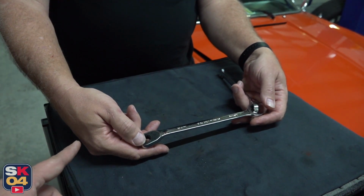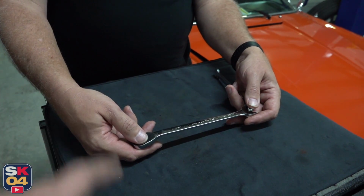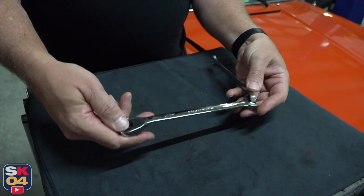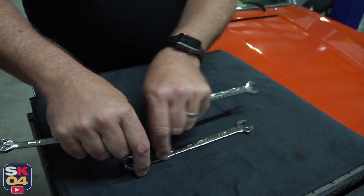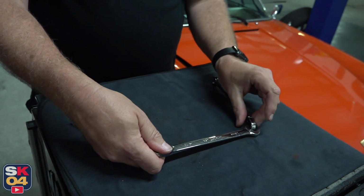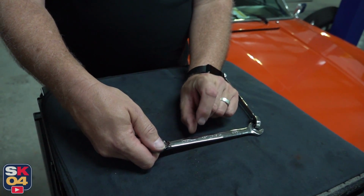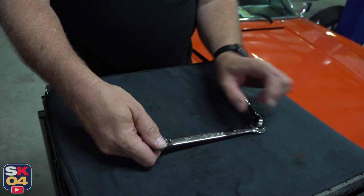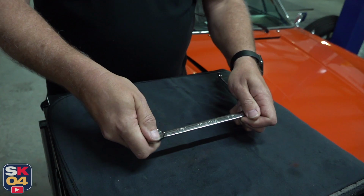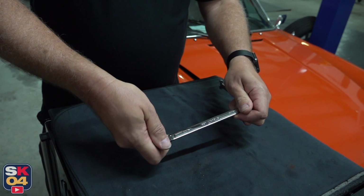With all the tire pressures double checked, Dan's going to work on disconnecting the sway bars before he starts making any adjustments, and I'm going to have Chris explain why. The sway bar is basically an additional spring in the car. A sway bar runs perpendicular across the car, with the sway bar arms attached to either side, or it's one single unit that spans the entire width. Based upon the diameter of the bar and the thickness internally, if it's a hollow bar, it develops the spring rate. As it twists up and down, it creates spring tension. That spring tension basically creates another spring in the car.